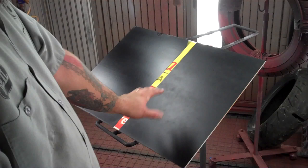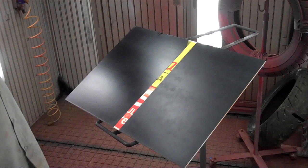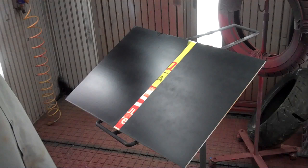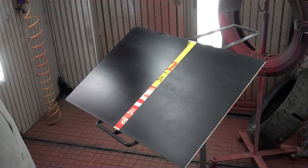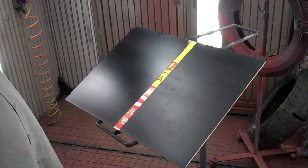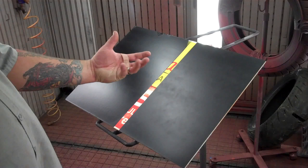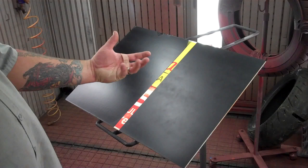It's a real close match to the denim black on the Harleys. Like I said, I've painted stuff you can't even tell the difference — it takes a little bit of practice. Just do a light coat and you'll match it up; if you want something more satin, lay it on heavy. This stuff will dry with the heat today in about four or five hours, but I'd let it sit overnight. Give it a week or two weeks and it'll set up pretty tough. This is good paint — it's John Deere paint, it goes on tractors, so it's going to last a long time, handle the elements, and it won't do that chalky white stuff that flat black primer does. This is actual paint, so it's going to hold up.